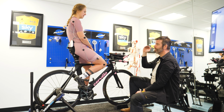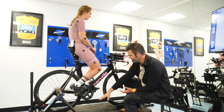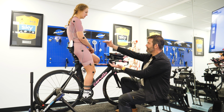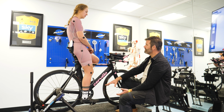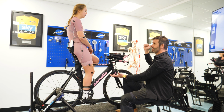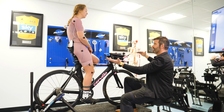Because let's make a big difference. Your saddle height, when we do that, if you come down to the bottom of the centre here, when we change crank length, this is my method of doing it, we want to open up the hip at the top. So when this crank length shrinks 10 mil, which doesn't sound a lot, but it's massive. We're going to raise the saddle height because you had a really good saddle height. So we want to maintain that.